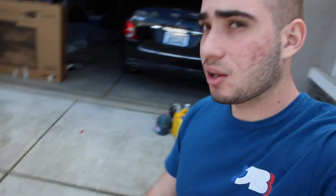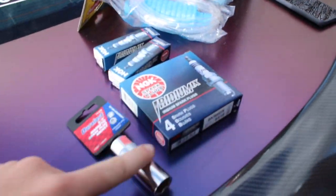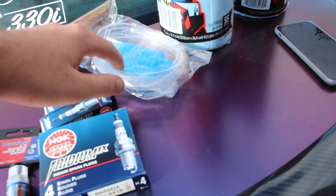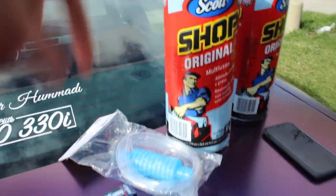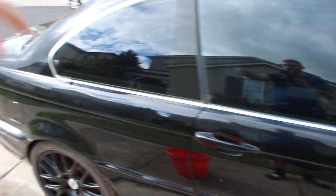The engine's not firing in those cylinders — it's not saying a misfire, it's just not firing. Could be the gunky oil, could be the spark plugs. At 130,000 miles it's about time to replace them. We're going to AutoZone. We're also going to recycle the old battery — should get about $18 back — and recycle the old oil. We picked up spark plugs, a magnetic spark plug socket, two pumps to siphon the gas, and some rags. We're not giving up today.